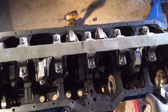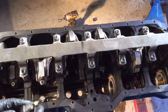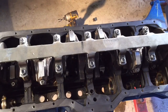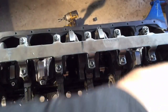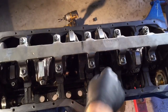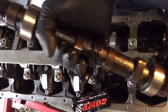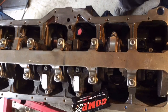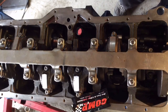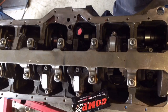These little pumpers really help — just going to cover all the bearing surfaces. Once you pre-lube the engine by spinning the oil pump, these will all get lubed up anyway. All the lobes are all lubed up, now it's time to insert the cam. Take your time, go nice and easy. Just make sure the lobes don't scratch the bearings on their way through. It's just a time-staking process, just be careful.